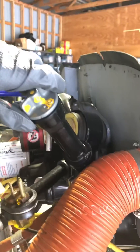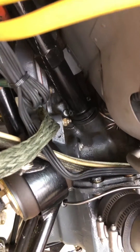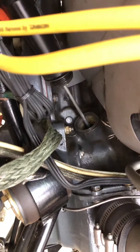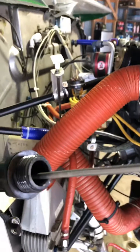I'm now going to remove the plastic dipstick tube. If you look down towards the base of the engine, you can see that I've cut the safety wire, and now it's just going to twist out counterclockwise. Once I get this out, I'm going to let you take a look at the threads at the bottom — just remember this entire tube is plastic. This serves as a reminder of why not to over-tighten, because this will break against the metal case of the engine. You can see the dipstick out of it, and we're going to zoom in for the threads.